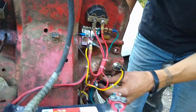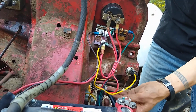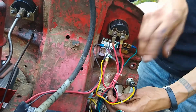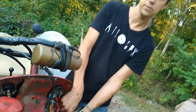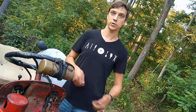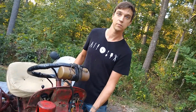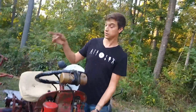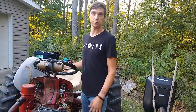This is some weird aftermarket funky push button switch that's been put in there. When I did the wiring for the new switch for the headlights, I put in a 2-pin weatherproof connector, so when you put the hood on, you can just plug the headlights into the connector. You don't have to fish the wiring out or try to get the wiring off of the switch. You can just plug it in and unplug it. So when that hood comes over here, I'll plug it in, and it'll make removing the hood a little easier.